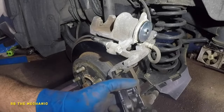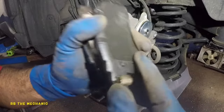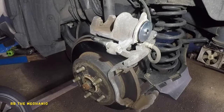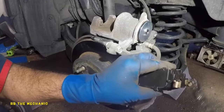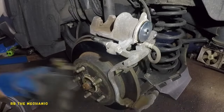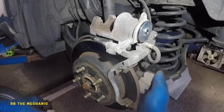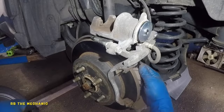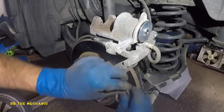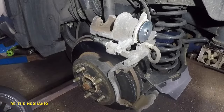You should be able to put the pads on just by squeezing them on. When you buy brake pads, try to get good ones and make sure you ask if they come with hardware. Put a light minor greasing on any point where the pad will make contact with the bracket. Remember, these go to the bottom. Install them, and the pad should sit all the way flush.